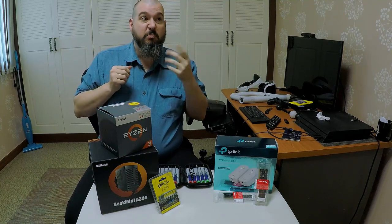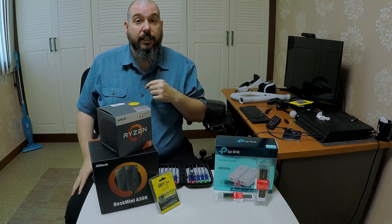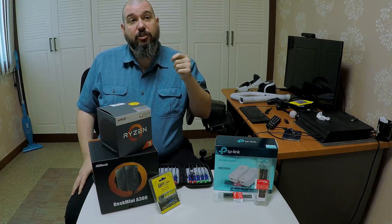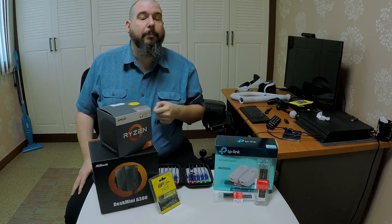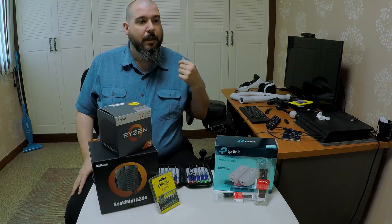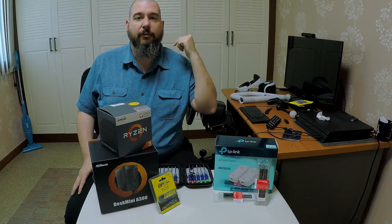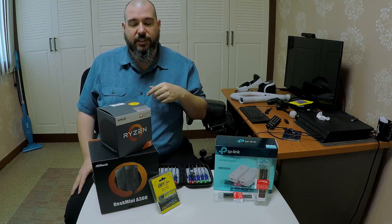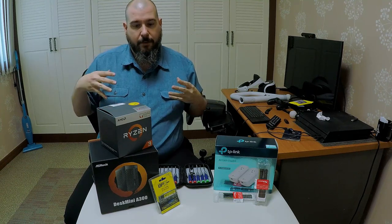So for the four or five people who actually watched the last video where I upgraded the laptop that we do our streaming off of, it still is not at the level that I want, mainly because I bought the wrong laptop and it doesn't have a powerful enough processor or enough memory. Also, the Wi-Fi, I think, is a single band Wi-Fi card, so it only connects at 150 and doesn't even see the wireless N band. So I am gonna upgrade.